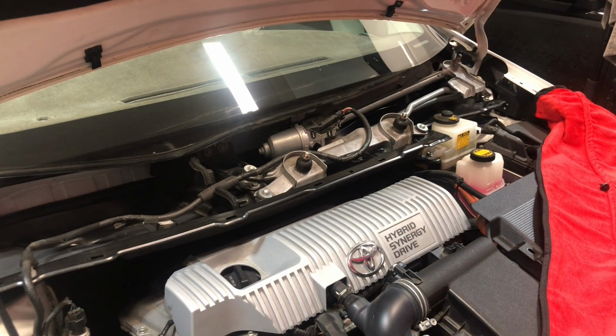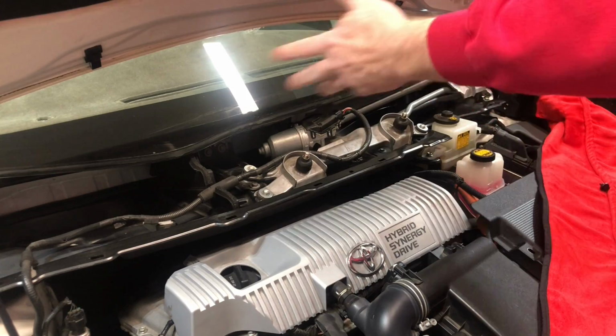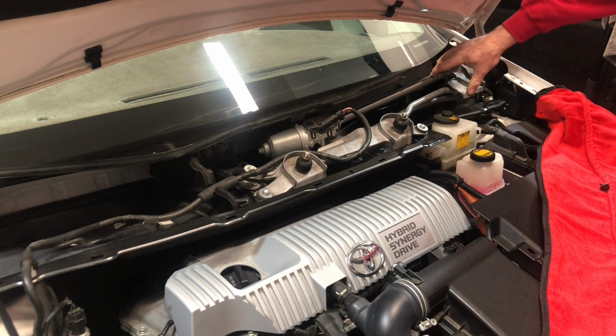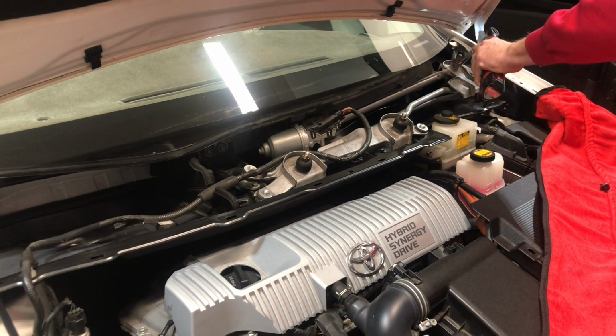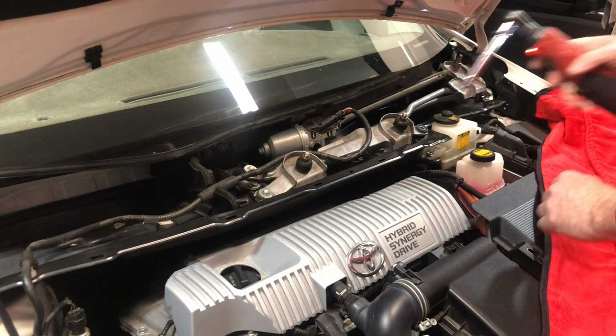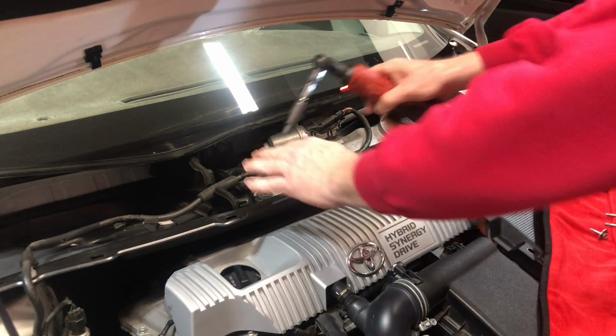Now you can see your wiper motor assembly here, and then the steel tray that needs to come out. And then we have free access. Everybody kind of worries about taking this out, but it's very easy. So these are all 10mm bolts. So we will just take these out real quick. We'll take the one for the wiper motor first so we can get that out. And there are 3 of them on this side, and there's one up in the far right corner.